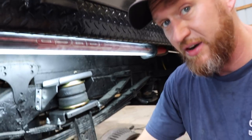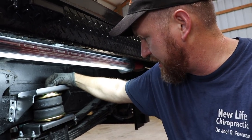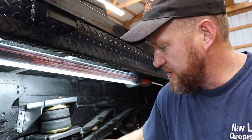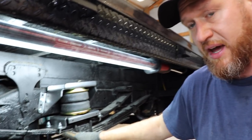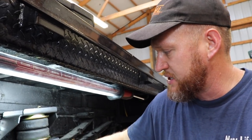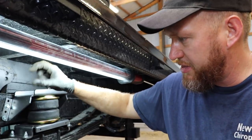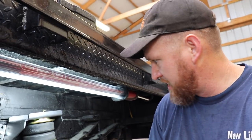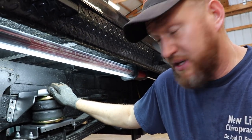We finally got it all mounted on there, all locked up tight. I just have to hook up the airlines as the next step. One thing I did on the driver's side was address those super long u-bolts. What I did was take a regular galvanized 3/8 nut, put it all the way down to the bottom on each side, then took the grinder and cut them off, unthreaded it, and those things started right back on. So it was super easy and quick compared to the other side. Everything is measured and equal to spec, all tightened down and good to go. Next step is to put the airlines on.